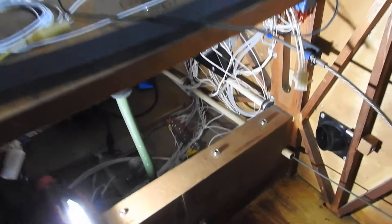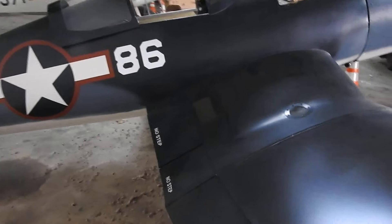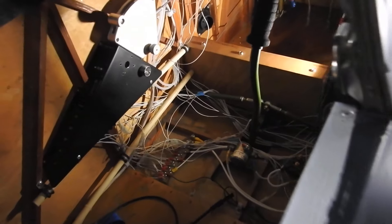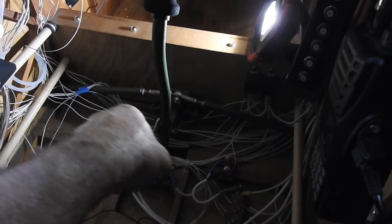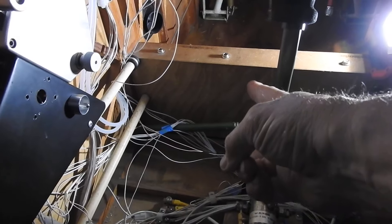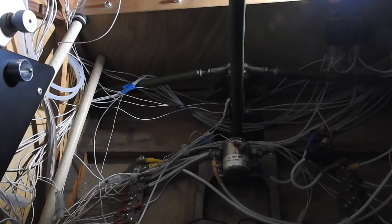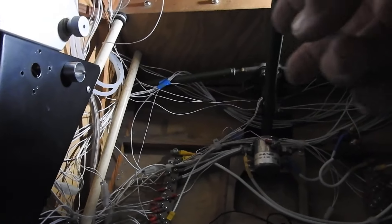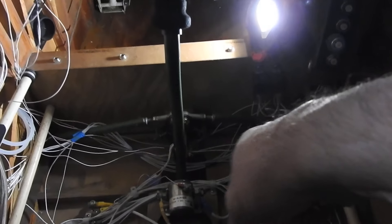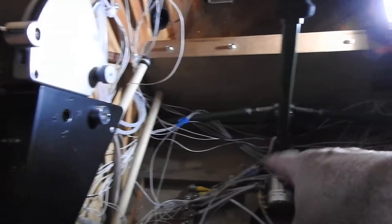It was a treat getting in there today. I'm going to go ahead and turn this on — if all goes well, we should see three greens. I had to pull these wires all loose to fish out the others. I taped up the ones I didn't need to cut, because four of those wires had to be cut, and two of them had to be wired into one relay each — one for up, one for down for the gear relay. Three wires for the left gear, three wires for the right gear, so they all come up under there.